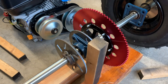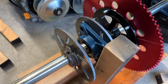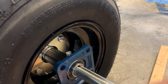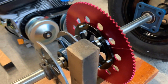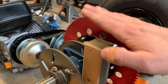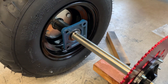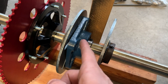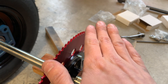This is a basic mock-up of the axle. Of course it's missing a lot of things, but I'll try to explain it. We've got this center support bearing right here, and we've got a bearing on each wheel at the back of each of the hubs. We have twin mechanical brake discs and a giant sprocket here. The engine is going to be mounted to the axle, and to enable such an insane mounting scheme, we're going to have bars across here, mounting to the middle bearing and to the outer bearing, with a plate on top that the engine sits on.